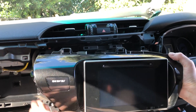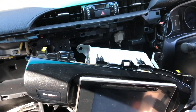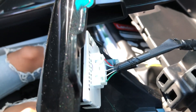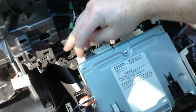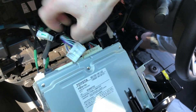The stereo is actually held in by about eight clips only. Once you've undone that it'll be a bit tight, but there's a little release tab on the right-hand side plug — push the release tab and undo it. Do that on all these plugs as well — press the top and pull back. I'm going to go through what all these plugs are because you're going to use pretty well all of them again on the new stereo.